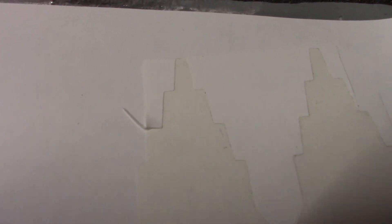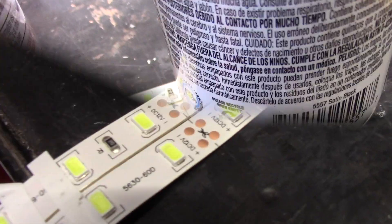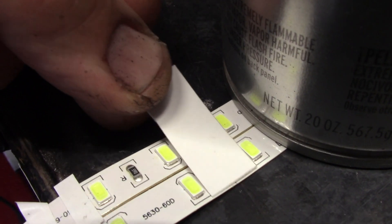It's basically the bulb plug that's converted to wires so that you can solder the wires to your LED tape. To join the two LED strips together, just cut little ⅛ inch strips of sticker vinyl and go between the LEDs and the little IC chip — just make little strips to fasten the strips together. Jump across where the solder dots are; you can go really big with the sticker and cover them up. Here's what your strip should look like after you've taped them together. You can just take scissors and trim off the excess hanging off the edge.